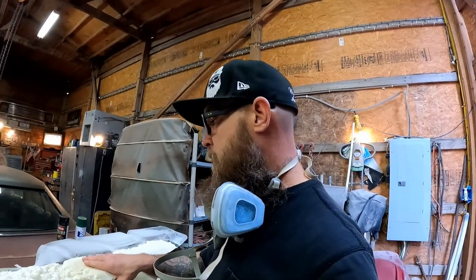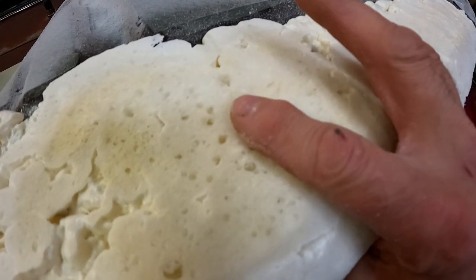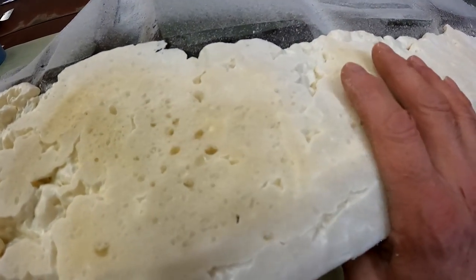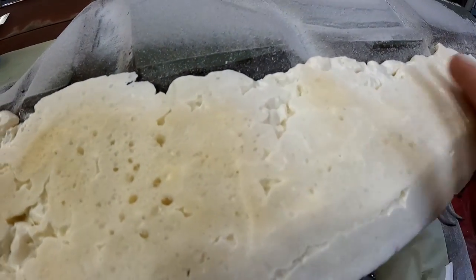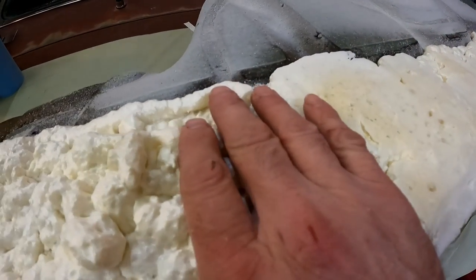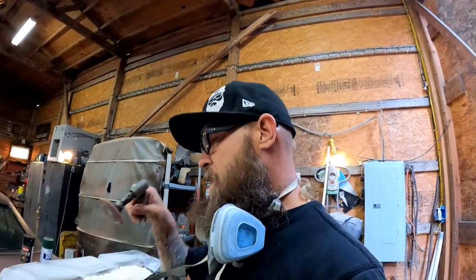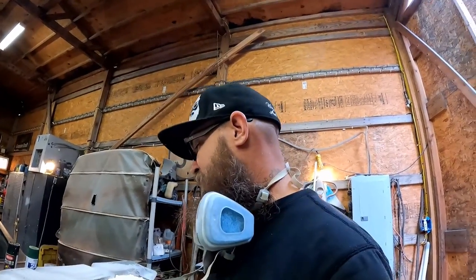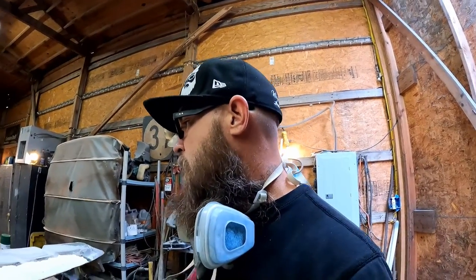Keep an eye on it. If you find it's really soft — which is exactly what happened here — that's the thickest part of this entire dash. Just give it a few more minutes now that I've worked a layer off the top. Give it another 20-30 minutes and it'll be fine. Just slow down, take it easy. If I had been digging at it aggressively, I would have popped right through and it would have been a lot more work.